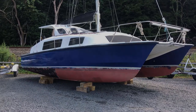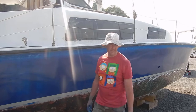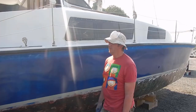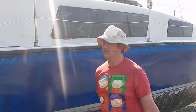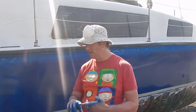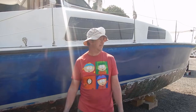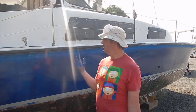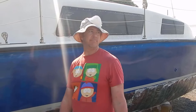First coat. A beautiful finish of my first coat of blue didn't last very long. I'm in the process of sanding the entire boat down again with about 220 grit sandpaper. Because I can't do subsequent coats at four-hour intervals — I always have to wait at least until the next day because of my schedule, my obligations with work and with the fire department and social and family commitments. So I can only come down here for a few hours at a time, and I can't paint more than once per day. As a result, I have to sand down layers of paint in between coats so it gets a good mechanical bond and ultimately looks very nice.